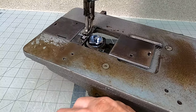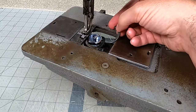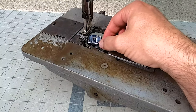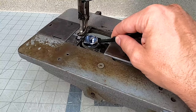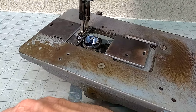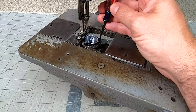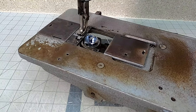When you're putting together your bobbin case, you have this little half-moon shaped piece that goes right in here that holds it in. You want to align the hole right there, take your screw, put it in there, get it started — I'm going to put the camera down and use my other hand as well. I can move this over a little bit and get the other one in.